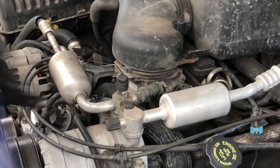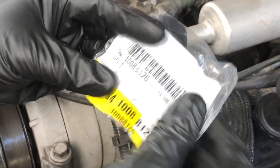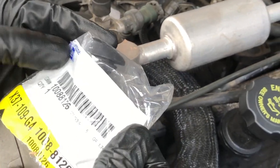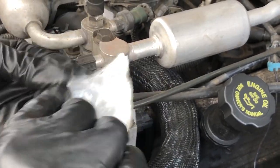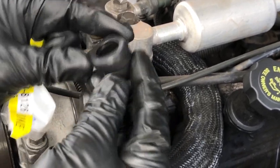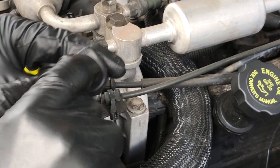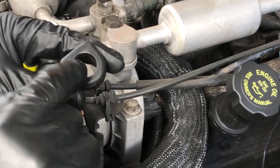The grommets themselves are a different part number, and the part number on these grommets is 10088126. You can pick these up online or on eBay — I'll put a link in the description for both of these parts. What's inside the little baggie here is just a little rubber piece that's going to fit into the sheet metal of the valve cover, forming a grommet for you to plug things into, like that emissions pipe on the passenger side or the PCV valve here on the driver's side.